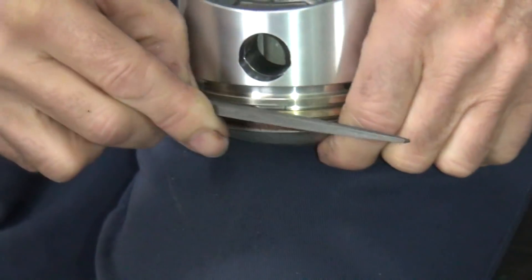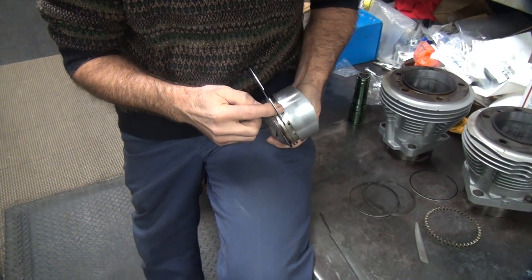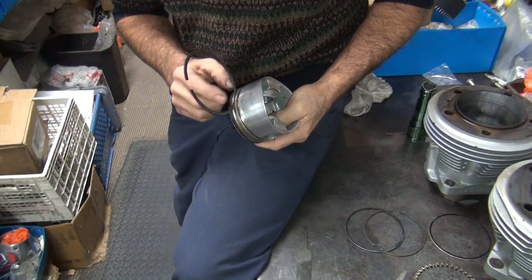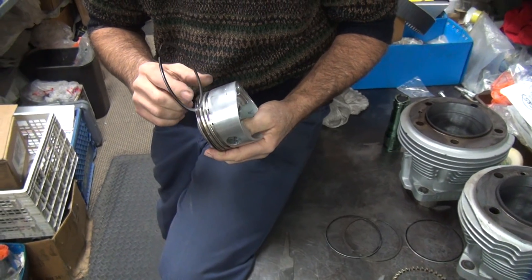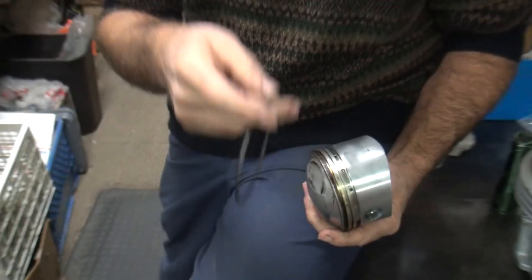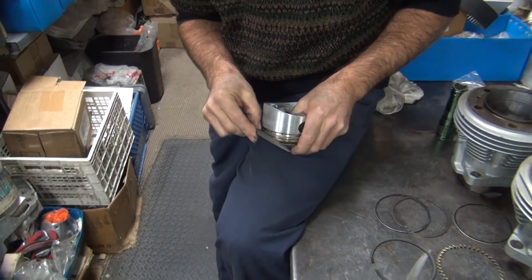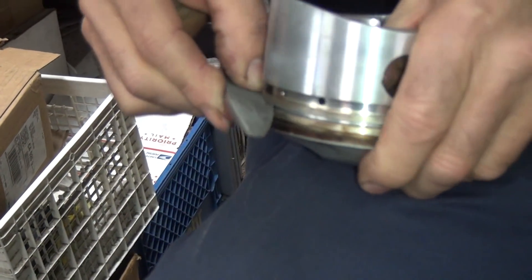Now this is the kind of crap you do at the racetrack and you've got nothing else to do, but you do have your fingernail file with you. If it takes three hours to do the job with a file, that's what you do because we want to go racing. Let's throw it in a lathe. See how it's a little bit better than it was - still a little sticky, but it's right there. See it's high - let me drop it back down. We've improved it - see the high spot? This might not be in the Harley service manual, huh? They would probably recommend buying a new one.